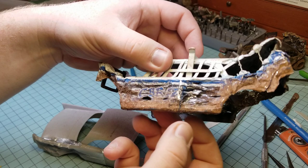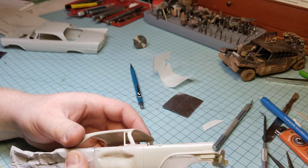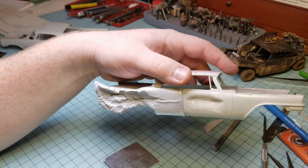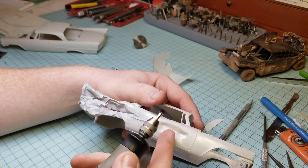There's plastic behind it. Panels are covered, but there's still dents and gouges and whatnot in it, just because it looks really good. And especially if you plan on building 80s and newer stuff, Crown Vics, what have you, that torn sheet metal is a lot more common, it seems, on those cars than it is on old iron, for instance. So what you're going to do, dent your door in a bit. Don't cave it in all the way into the battery box. Then you're going to cut. Leave your raised section here, your raised section here.